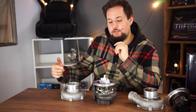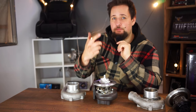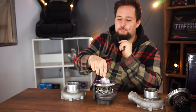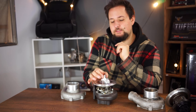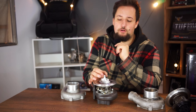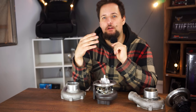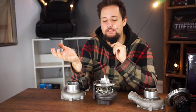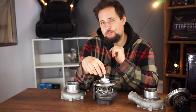Some things have to be said: the flutter that you can hear is also not really that great for the turbo. The air coming back from the intercooler piping goes back out of the compressor housing and gets chopped up by the turning blades — therefore making that flutter sound. This is also why the shafts get some shock loads. It's not really damaging in a way, at least on lower boost levels like below 10 psi, but durability can be decreased.